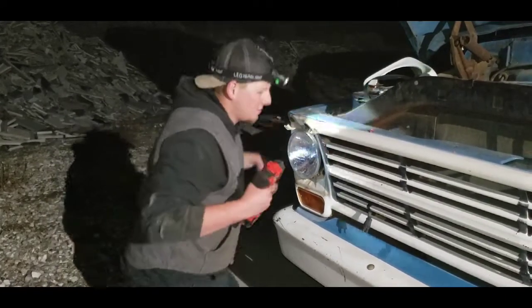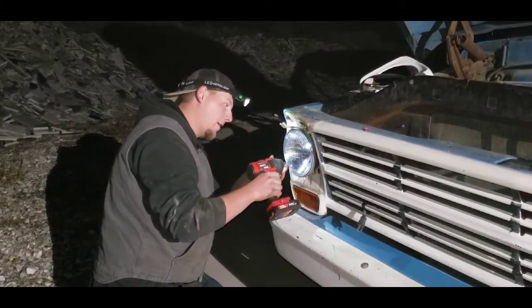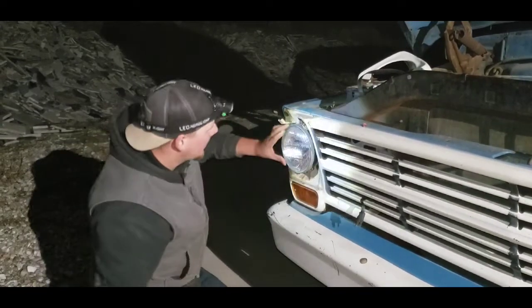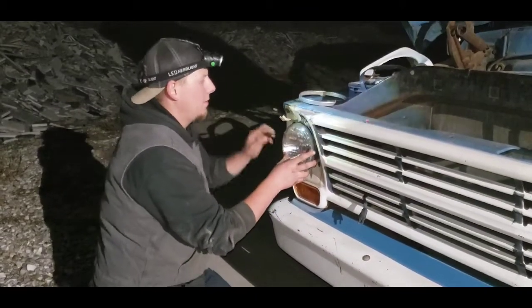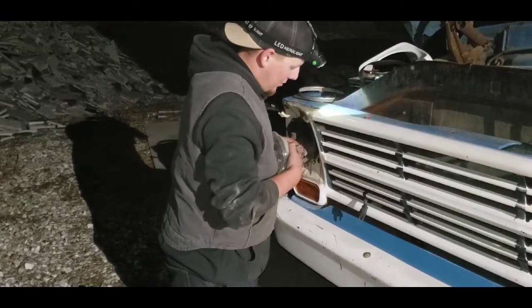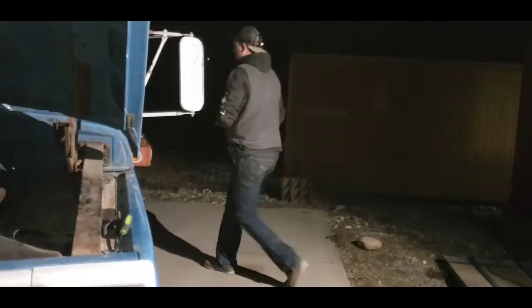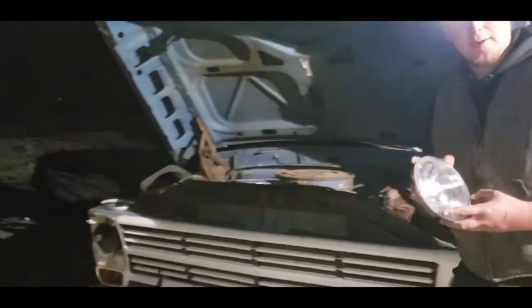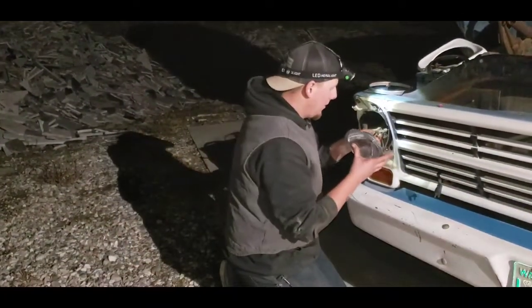So it's not going to be quite as slick as the other side just because you used a different size screw for one of them there, but rotate it. Boom. There you go. That's out. Now these are super old connections, so they're a little bit hard to come apart, but not too bad. Old headlights out already. Walk around, grab your freshie. You know, like 15 bucks a pair at your local O'Reilly's Auto Parts. Sealed beam halogens, ready to go.